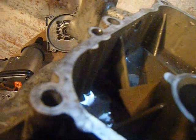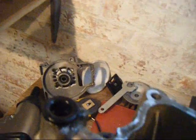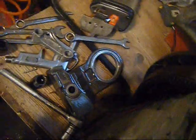You should have seen the state of this though. This is the sump. It's crap light. This here, it's got little chunks of crap in it. It's not metal, I don't think. Okay, yes, some of it is. No, that's little white paint flecks in this. I accidentally put oil in it without filtering it because I was recycling engine oil, which you really shouldn't do.